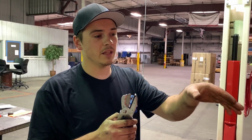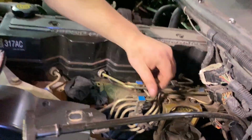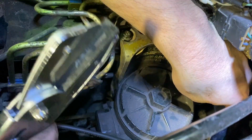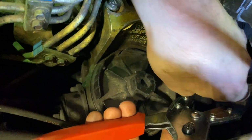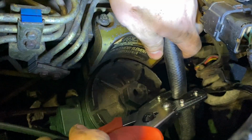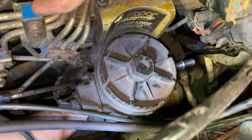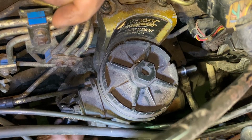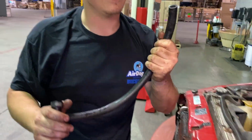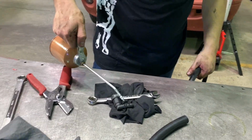We got our cutters, and we're going to cut that hose to length so that way we don't have any excess kind of flapping around. So I'll jump up here and kind of hold this hose up to where it's going to go. That right there, once we take into account you need to press your fitting in. So I'm going to go ahead and just cut that right off. Okay guys, now that we have our hose cut to correct length, we're actually going to go ahead and remove this 1/2 inch hose back out from the truck. That way we can push lock that fitting in on the bench, because it'll be a lot easier. It'll be pretty tough to do that when it's up inside the truck like that.